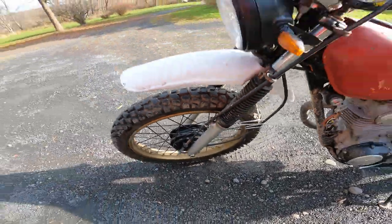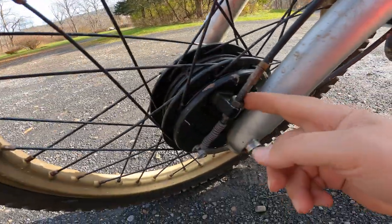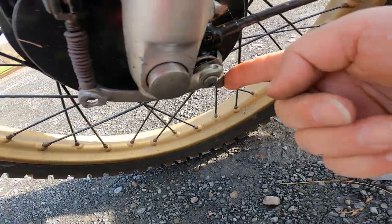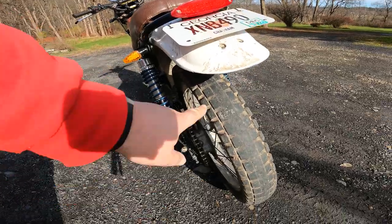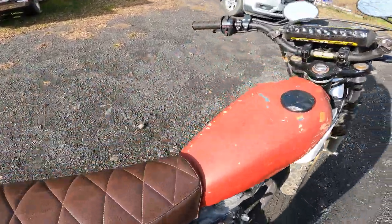I adjusted the brakes a little bit because they got a bit touchy — they're drum brakes — so I adjusted those and that's pretty simple. You loosen this guy up, loosen that guy up, up or down. You could do some adjusting here if you have to but I didn't have to. Other than that, still need a back tire — that tire will get me a ticket if I go out on the main road. So I'm not going out on the main road until I can get a tire for it. But other than that, the bike has just been running great.